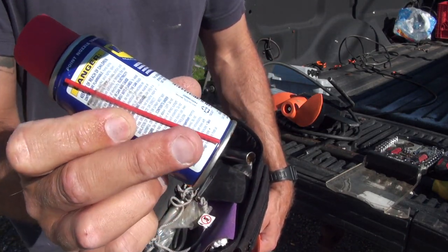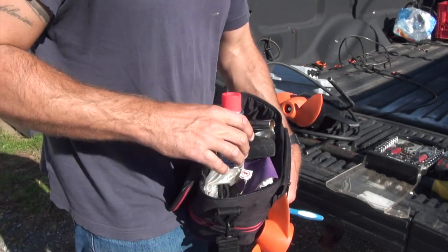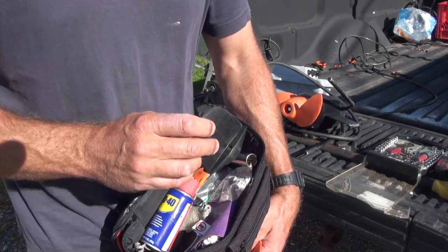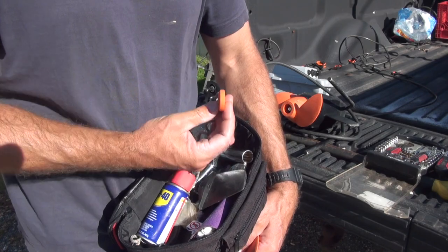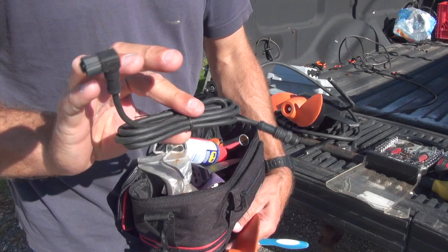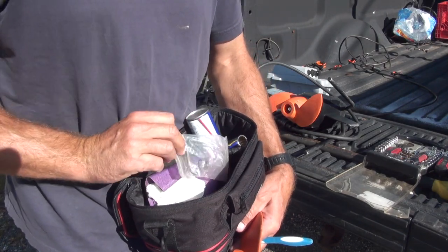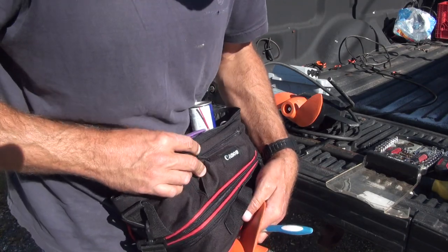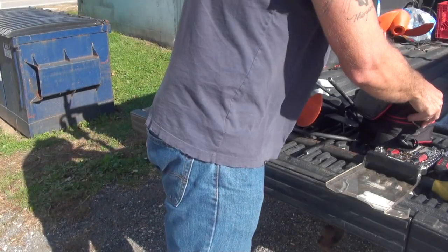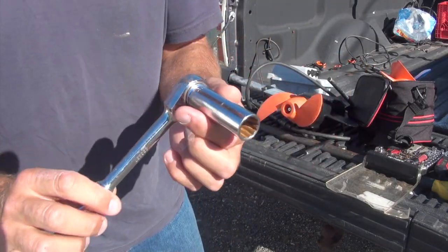You're gonna use that spray nozzle to really blast it — aim it in there and it just blasts all that dirt out of there. I carry sometimes a spare skeg for the 403 even though I'm not running the 403 that often. I already mentioned the spare magnetic key. I keep a spare data cable with me and some shear pins, and the most important thing that I carry is a 17 millimeter deep socket.